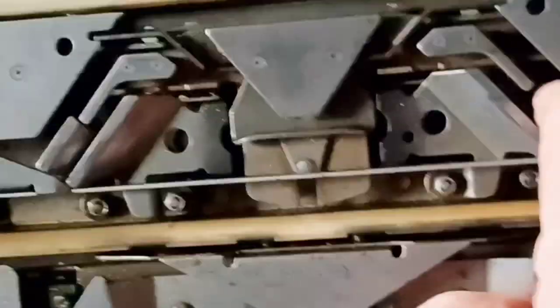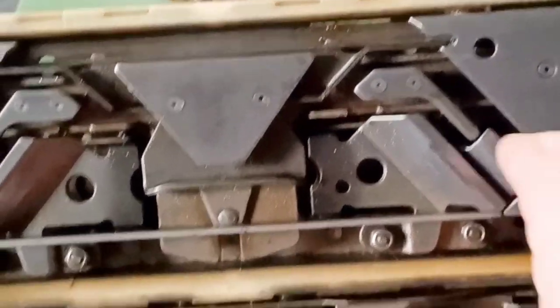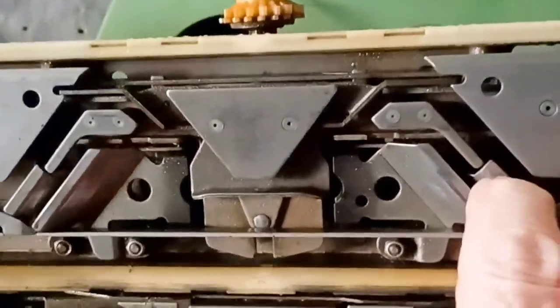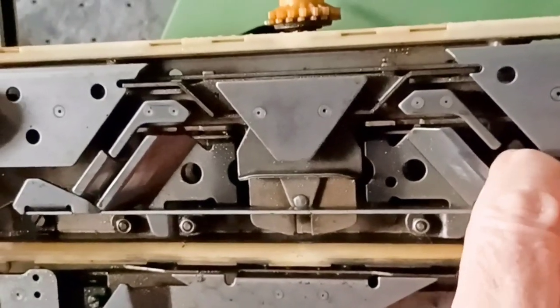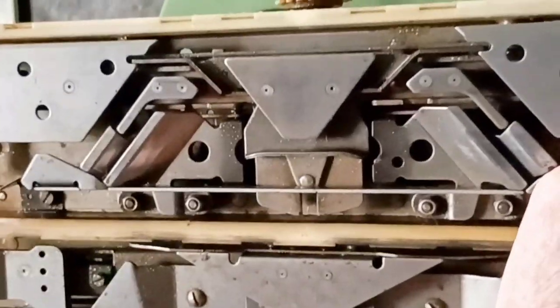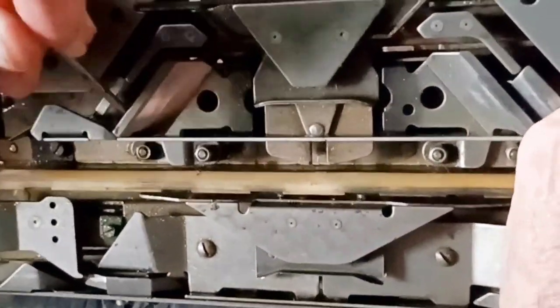Now notice when I do that one by itself, it's the same thing. There's a lock nut on a rod with a little tiny spring under it. See how the rod will drop down? If that rod doesn't drop down when I hold that in, then there's too much corrosion under there. Besides, a spring could potentially be broken, but it isn't often. Corrosion could prevent it from reacting properly, just too much buildup. Now see, upside down, again, the rod drops once the spring pressure is taken off.